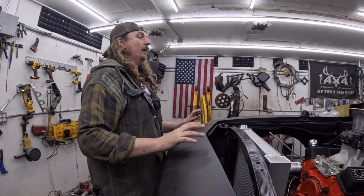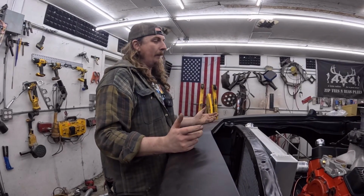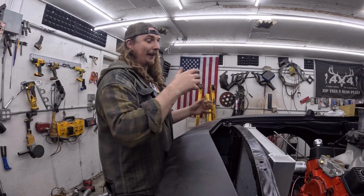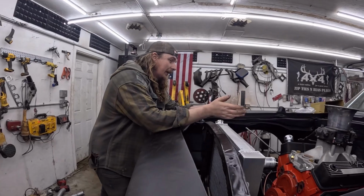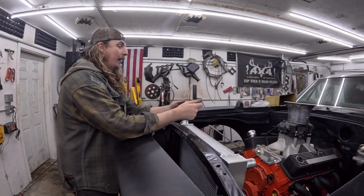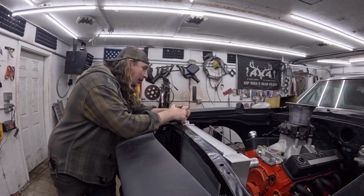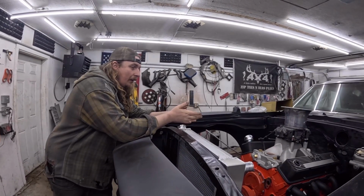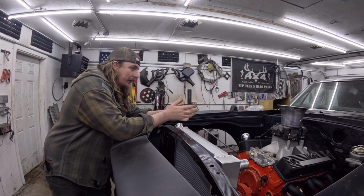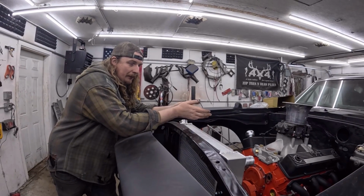So I think tonight we'll rip it all apart, motor and trans out. The transmission and the motor have to separate. And bearing flipped back in, it'd be fine. The problem is, this transmission did not go together well. It was really, really tight. I had to kind of jostle it and tighten it and get it in there, and it was a hassle. My fear is I'm going to try and pull the transmission out of this thing on jack stands, obviously, and then you've got to bench press it back in, and it'll just be such a hassle, versus pull the headers, pull the front clip off, undo the transmission mount, and yoink the thing out.